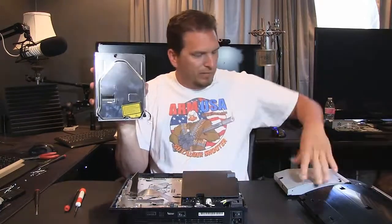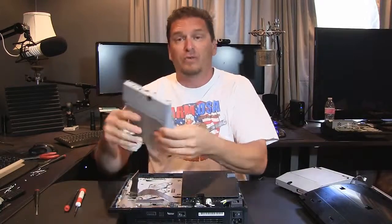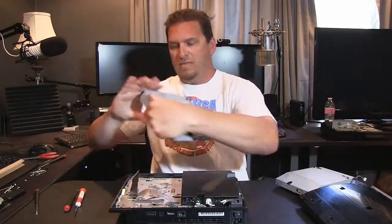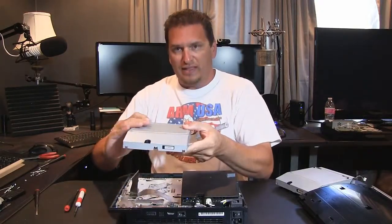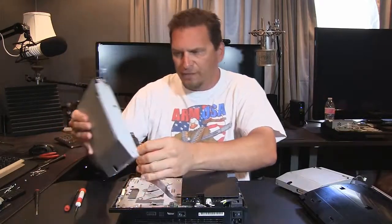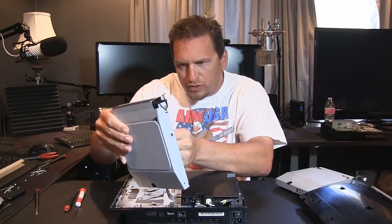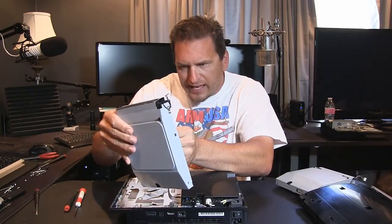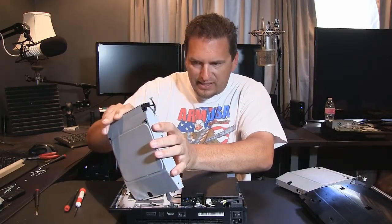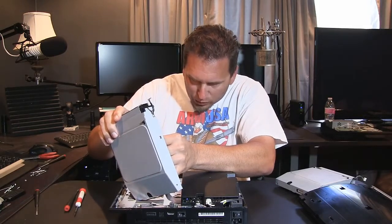You can see that this Blu-ray player versus this one, they're different. This is all newer stuff. That's why I'm going to get the newer one back together with where it was before. Now, make sure you orient the unit correctly. That will help you put your cable back in right, because the cable is actually fitted. So with the blue side facing out toward you, you want to slide your flat cable in there, and as soon as it's in there, with your other hand, I know you guys can't see this, you want to flop down the compression holder.